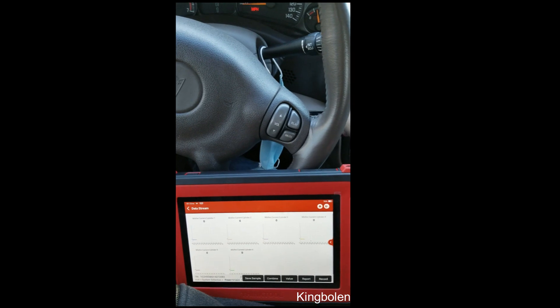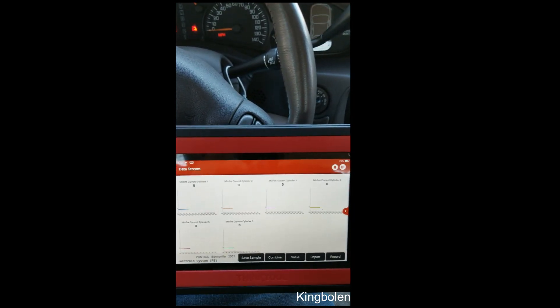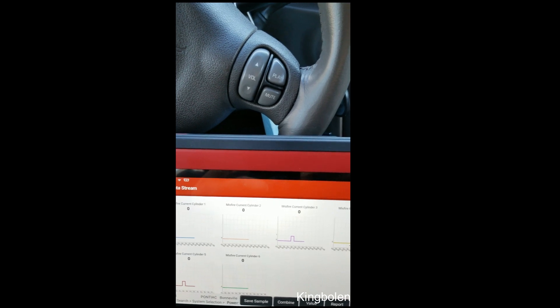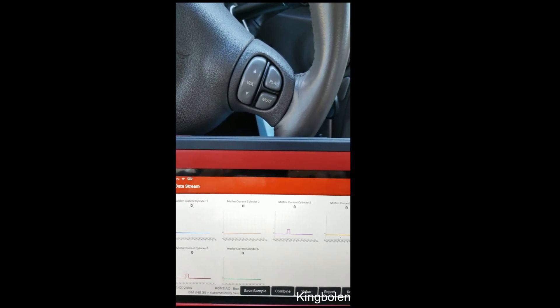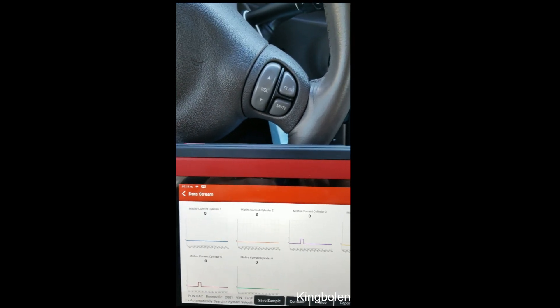So I was able to fix it, and it literally took me minutes — something that people struggle with all the time. Just for that it's worth owning. If you want to graph, you can hit the graph button right here and it graphs all the cylinders. You can graph all six or you can graph one. Right there — that showed a cylinder three misfire. Now that one I need to address, because cylinder five was the misfire I fixed. Look how fast that tool did that. I can't give it enough praise. I'm so glad I purchased it, and I hope you too will enjoy this tool. I definitely would purchase this again and look forward to doing business with this company again. They were very responsive when I had questions. Thank you very much and have a great day.